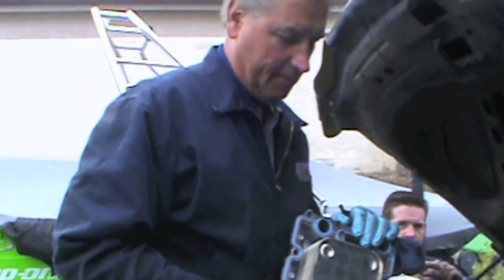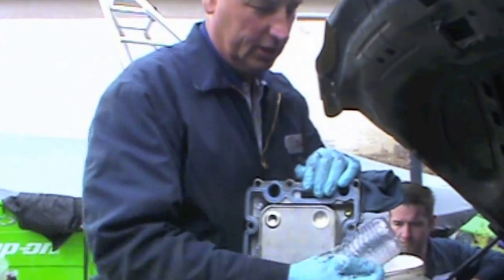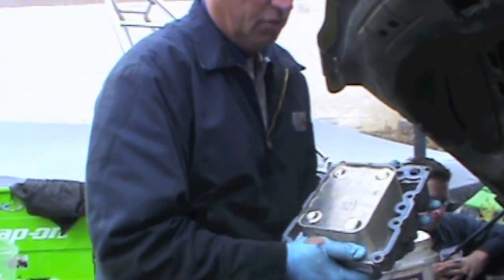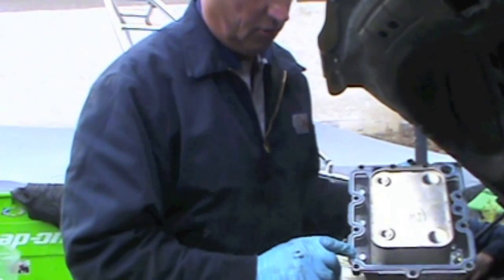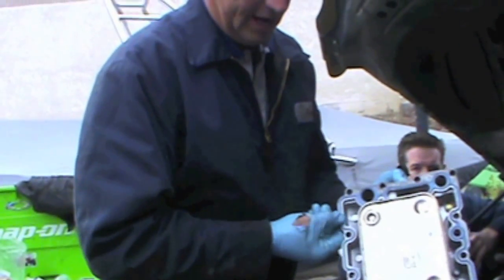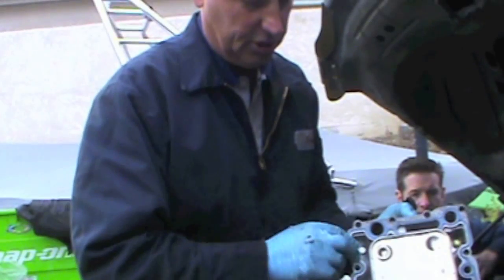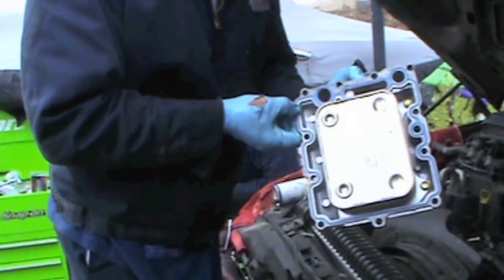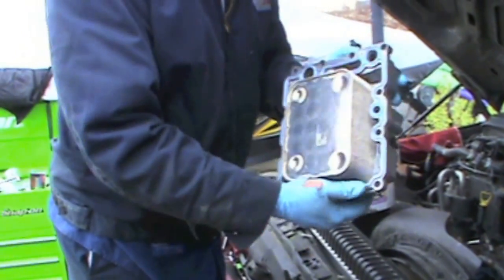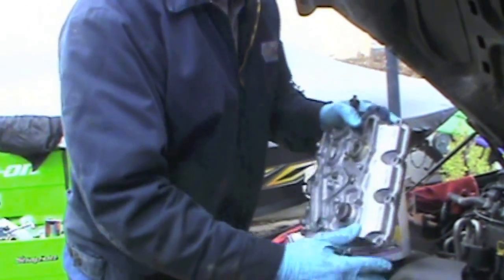I have the oil cooler put back together. I went ahead and bolted it down, torqued the bolts down and got it all tight. Put in the seal here. When you have the seal in, you want to make sure it's all the way seated and that you don't have it rolled any way. Sometimes if you push it down to the left and to the right you can actually get it to where the seal would roll, and that gives a passage for the oil to go through. So we have the seal all in, oil cooler all torqued — that's ready to be put on.